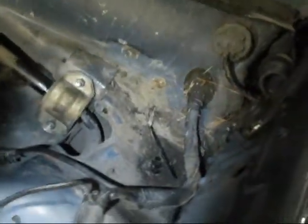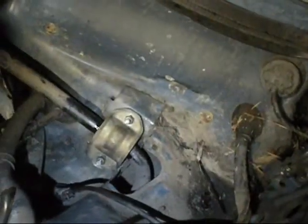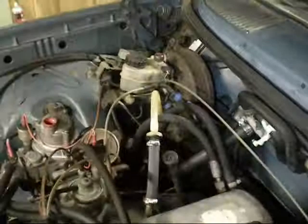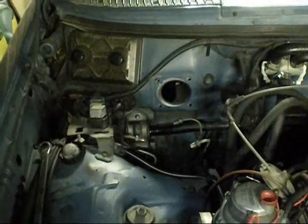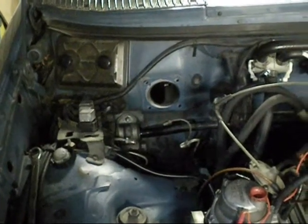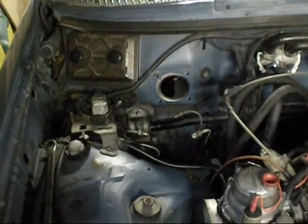While I've got everything out, I'm going to wash all this side out here, because you can't see all that muck underneath the battery. If you let that rust out, well that kills the car. Now you've got to do the fun side — you've got to undo the booster from underneath the dash. There we go, the driver's one done. I've got to change the master cylinder anyway. I figured while I had the battery tray out, I'll wash out all of this area. I've already done behind where the booster is, so it's all nice and clean.